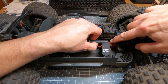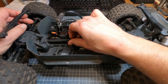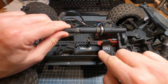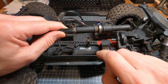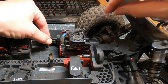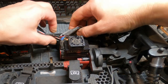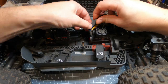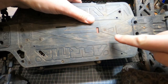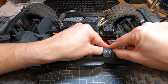I've covered this before, but I'll show you getting out the prop shaft — it's spring-loaded, so just pull that back, the bearing comes out in the middle, and you just need to pull the back bit out. It's worth checking that bearing once you've got it out. Next, just unplug the wires and move the little block out of the way by undoing this screw, then use the strap to help pull the unit to the side.